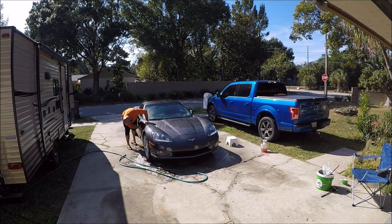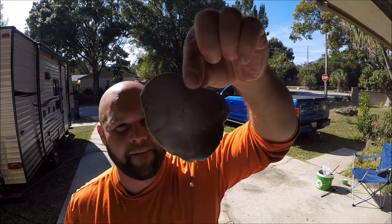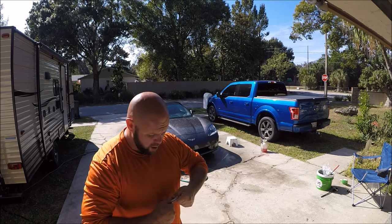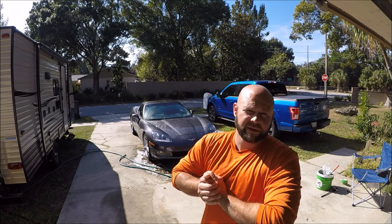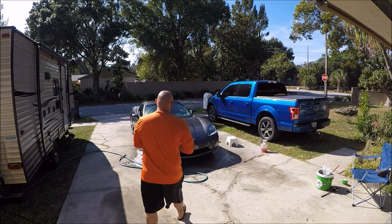On the lower panels, especially your front fenders, you want to watch out for tar and that kind of stuff — picking up a little bit of that right now. You don't want to put that on the paint, so you always want to knead the clay. You could even go as far as using a separate piece of clay for those lower panels, knowing the higher panels with nicer paint won't even be affected.